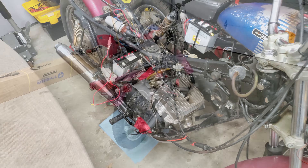Kickstart is back on and should be sorted — the gear was almost 360 degrees off from where the perch is, so we wound it all the way around and sat it on. We're going to put a new gasket in, put the side cover on — not putting oil in yet since we just want to see if we get spark. Also put a new o-ring on there. Not showing the cover install because it's pretty boring — if you have questions, comment below. One more thing on the wiring: a guy made up a wiring diagram online for the key cylinder — hopefully steady enough for you guys to grab a screenshot. Putting the cover back on now.